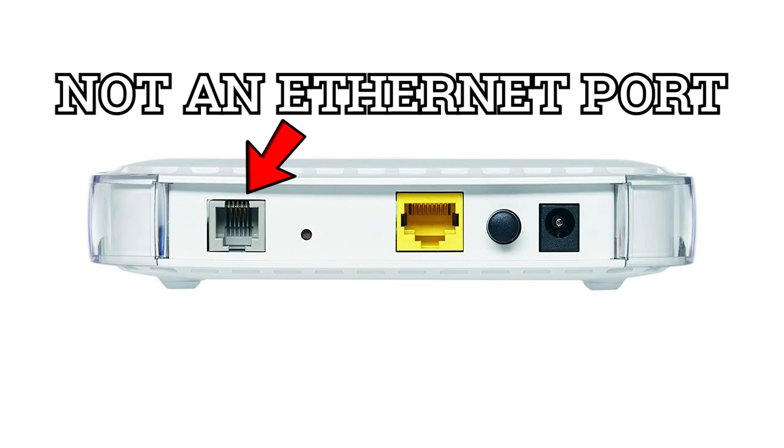If you wanted to be a bit OCD about it, you could use the last port on your router — port five or port eight — and then port one on the new switch, giving a logical daisy-chain. But in reality it doesn't really matter. One thing to note: if you're adding another Wi-Fi router rather than a simple switch, sometimes only one specific port supports auto-sensing for uplink connections, and it can look like a regular Ethernet port — don't confuse them. But with a simple gigabit Ethernet switch, connect anything to anything and it should work.